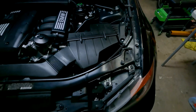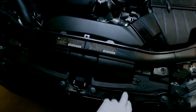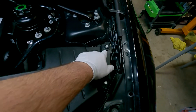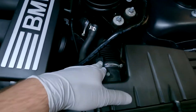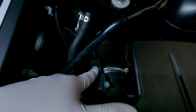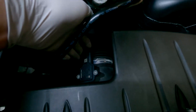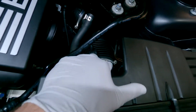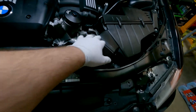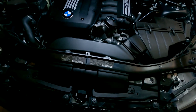Let's go ahead and start taking things off. There's going to be two clips here that we're going to use the trim panel for, two T20s, and two 10 millimeters. We have the clip here for the mass airflow sensor — just that middle section, be careful with it. Just pry up a little bit while using your other hand to pull the connector out, and the worm clamp there. This whole box should come out along with this section, and this section just pulls up and off.